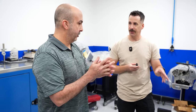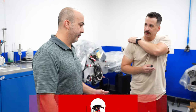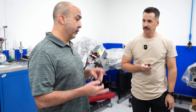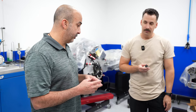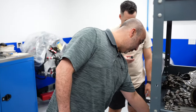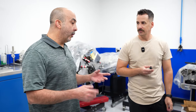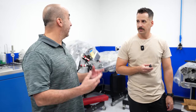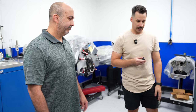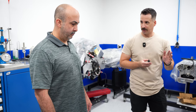And then the pistons — were you able to figure out what you're going to do with them? We took all the measurements. The first thing I do is get measurements — we CC the chambers, make sure the combustion chamber is the size we want. We measure what they call free drop, which is the distance between the valve closed and before it hits the deck — very important for piston-to-valve clearance. We sent all those measurements off to Diamond and Diamond is making us another piston. You'll worry about the cam too because a lot of cams require checking that piston-to-valve clearance again.